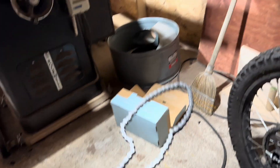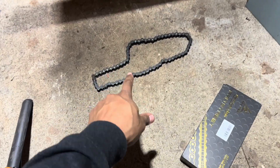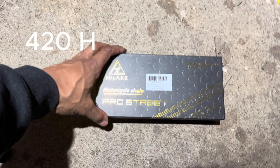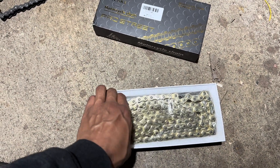This chain has obviously taken some abuse. I have noticed it gets warm when I'm riding, so I'm just going to upsize the chain. I ordered a 420 chain but this is a 428H, which is a heavy-duty version of the 428. So it's upsized, heavy-duty, and bling-bling — gold.